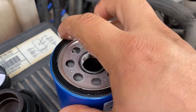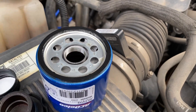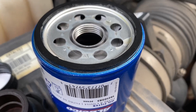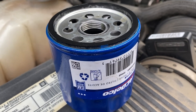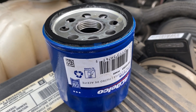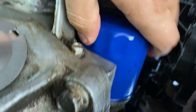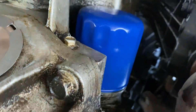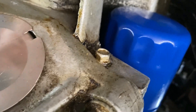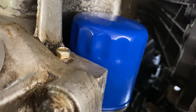If you like to have your hands nice and clean, you could take it to Walmart — they'll do it for you for twenty-five, thirty dollars. If you don't mind a little bit of oil, just put some on there and you could do it yourself. Now we're gonna go back under the truck and put the filter back in place — not over-tighten it, just firm. When you come to do it again you will not have a problem taking it off because you didn't over-tighten it. You will not need the oil filter tool because you did it nice and firm.